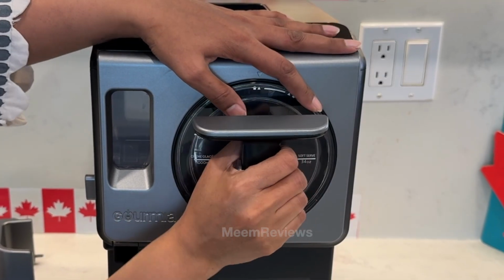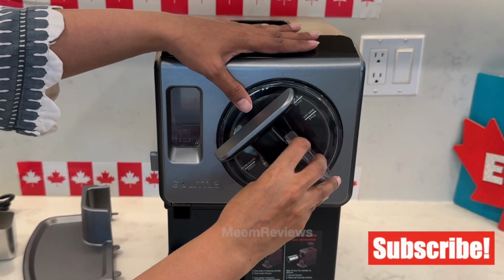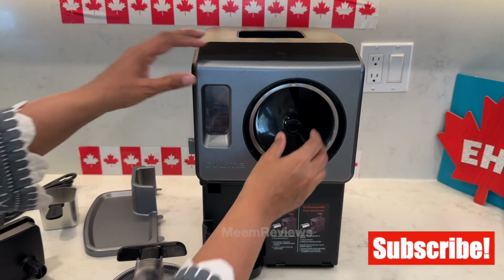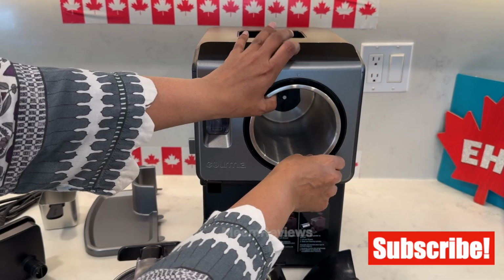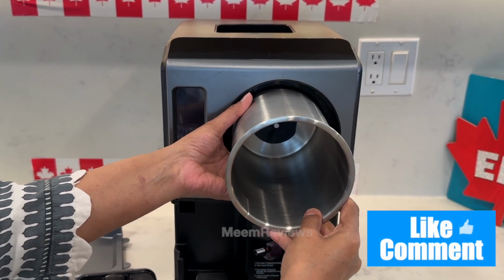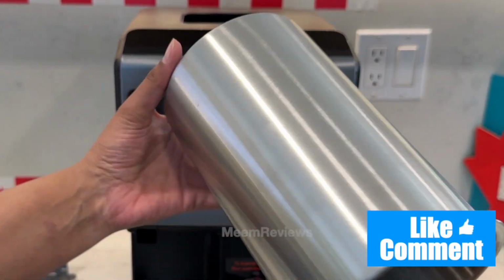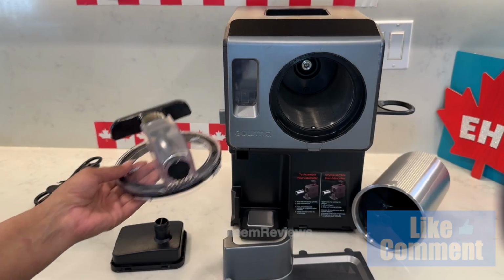Next, I remove the lid, which is a little stiff at first. You need to rotate it counterclockwise to the unlock symbol and then pull it off. Then I remove the auger by sliding it out and then sliding out the cylinder, and here you can get a good look inside the cylinder area. Also remove the topping dispenser and then give everything a good wash.